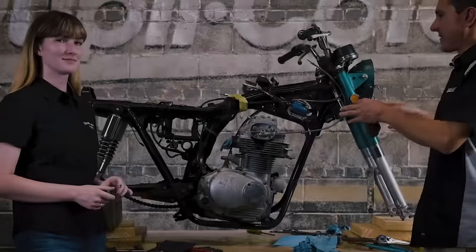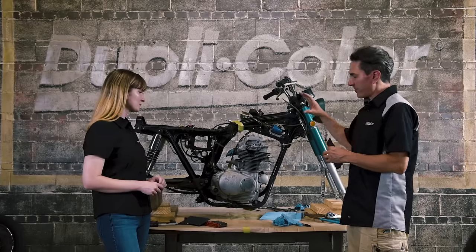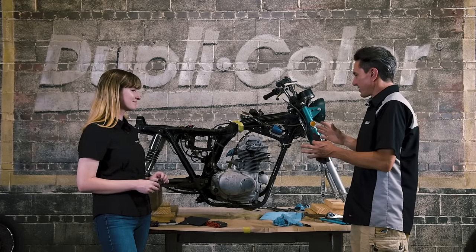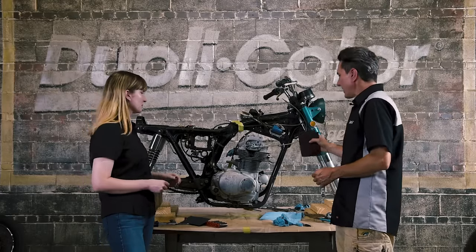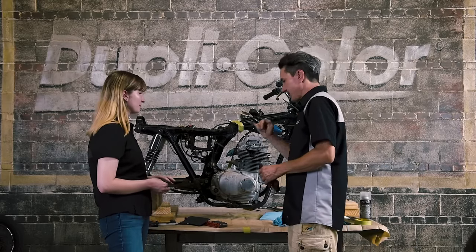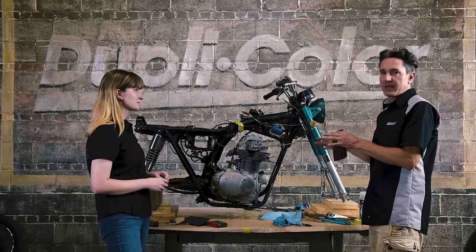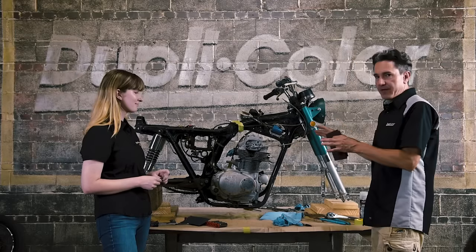We have the bike up on the table from the stand for an easier work level. We finished cleaning it and removed a few more components to access the engine more easily. We're leaving the engine in the bike frame since taking it apart further would be too involved right now. What we're doing now is sanding all the oxidized aluminum. There's also a lot of loose paint around the engine still — you want to take the emery cloth and get rid of that, because it'll come right off when we paint over it. Once sanding is done, we'll wipe everything down one last time with our solvent prep spray, mask everything off, and start painting the engine.